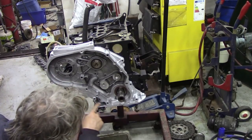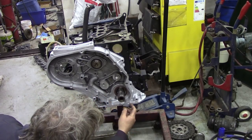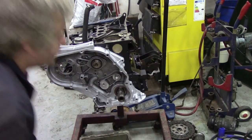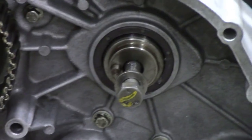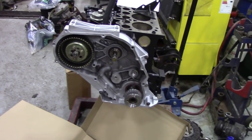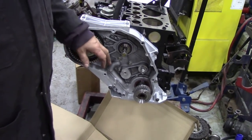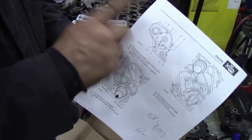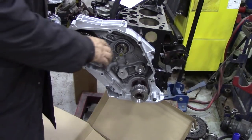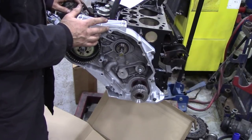The next thing we've got to do is put all the bolts in and top them down and tighten them down evenly — this is most important. I'm going to try and find a piece of documentation from Land Rover to show you how we put the bolts in. We're doing this 300 TDI engine. Tighten up the front cover on these engines — you need the workshop manual because there's actually a pattern to tighten them up. It's 25 newton metres, that's all. Don't reef and rave on them because otherwise that could distort the cover. I've fastened the cover on first, then put the pump on, so all that is nice and rigid now.